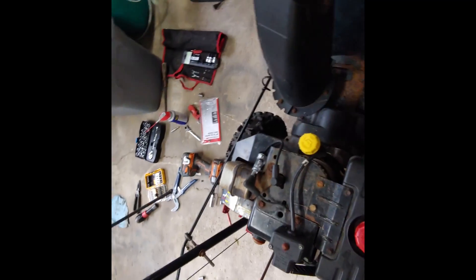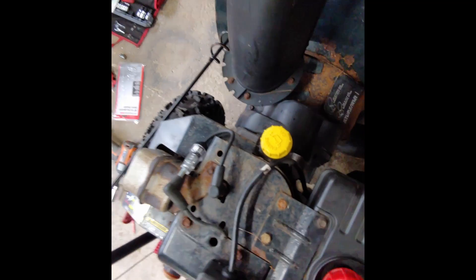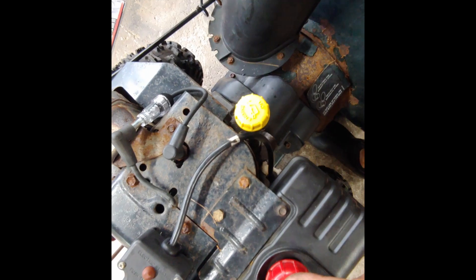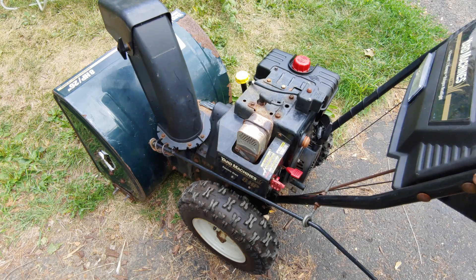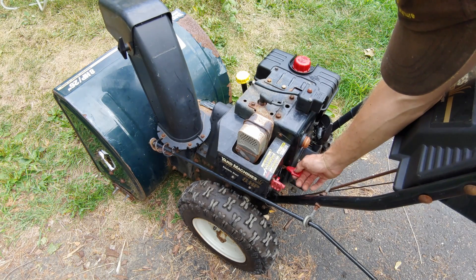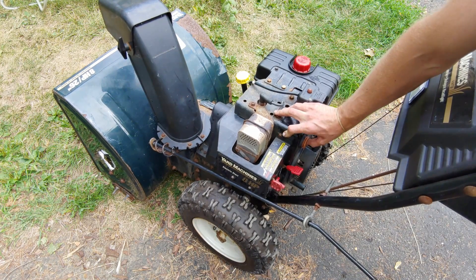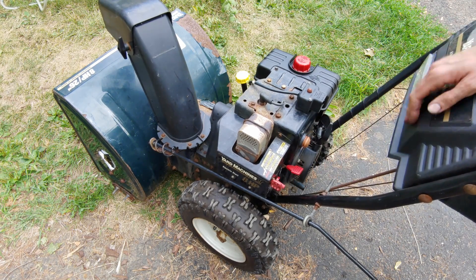That is a good sign. It's flashing at a constant rate as the engine turns over, and there's no fuel in this right now. So according to that it is pointing towards the fuel system, so let's put some gas on this now and prime it up, choke it up, and see what happens - and now there is spark coming through. I moved it outside just in case it actually does start. Choke on, a little bit of throttle action, maybe three quarters. Give it a few primes. I use non-ethanol treated gas. Float bowl's leaking a little bit, I'll have to look at that later.